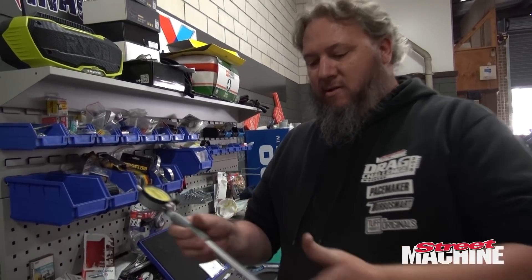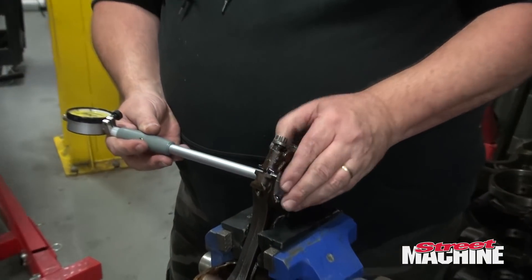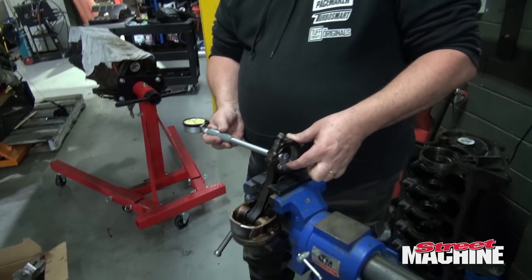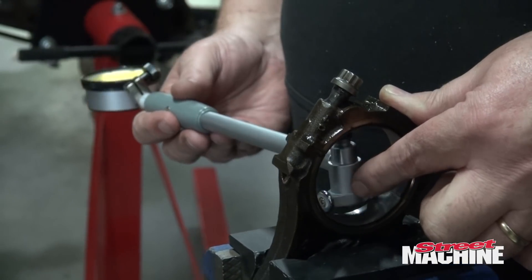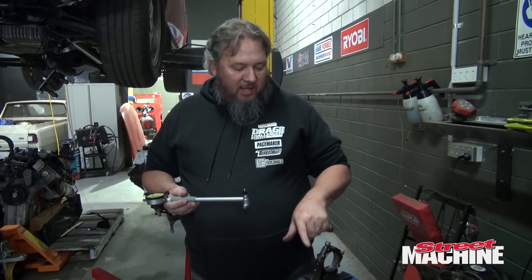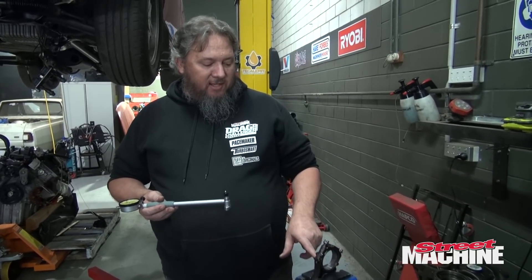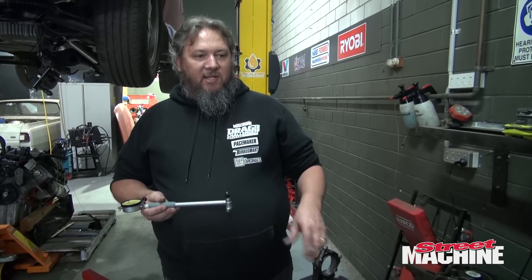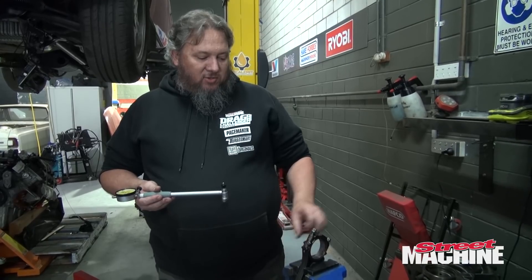We can take it over here and stick it in there — obviously I'm not doing this perfectly right now, just doing it fast. Stick it in there and you can measure the internal diameter of that area, which isn't bolted together at the moment. You basically stick it in, give it a bit of a rock back and forth, and you can work out what the size is. What we're going to do is a test later in the week — I've still got to get some ARP goo and the rod bolt stretch gauge, which still hasn't shown up. We'll tighten it up and see what the difference is to that internal diameter.